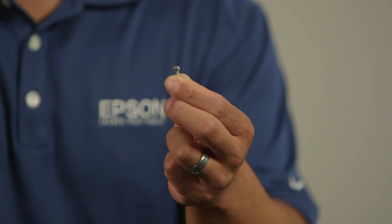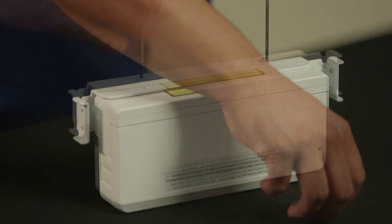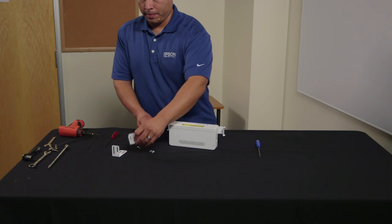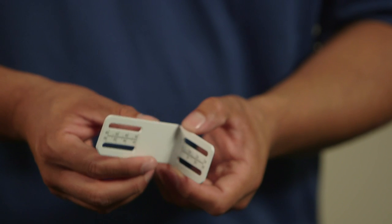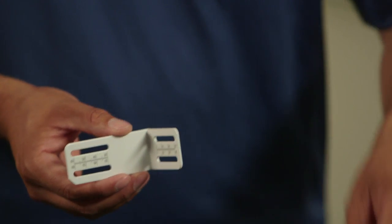Using two screws, we first attach the finger touch unit to the included finger touch mount. Then we attach the two adjustable length side brackets to the finger touch unit with two screws on each side so they are secured to the unit.